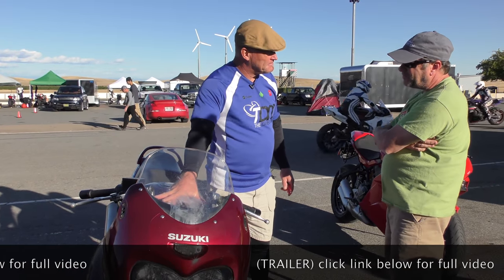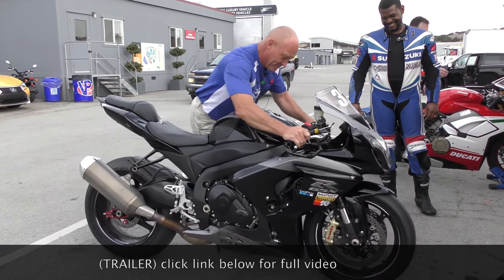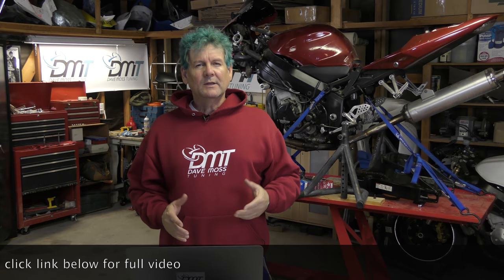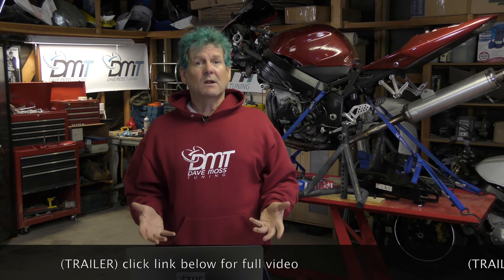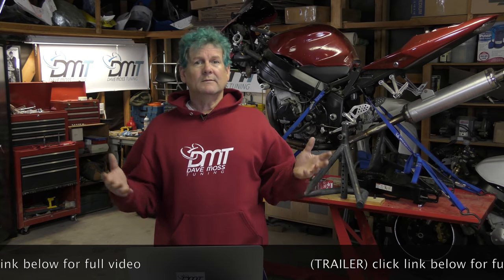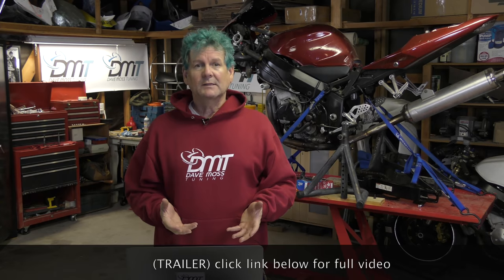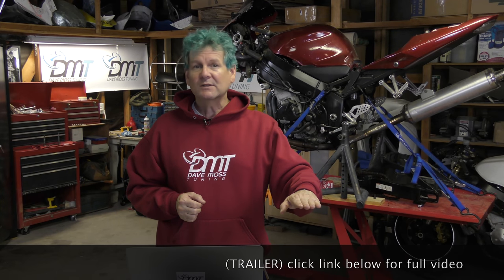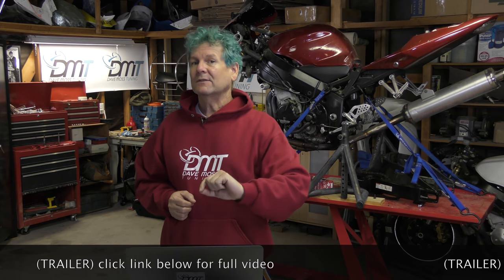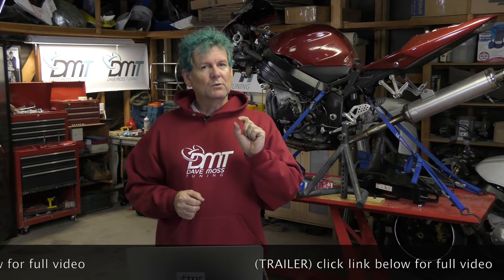Riding wise, you'll have to ride given what you have because I can't improve this at all. As with shock rebound, as you get closer to having it set right it might get a little frustrating — is it too slow? I thought it was too slow but it turned out to be just right. There's an entire video about how to bounce and set your rebound — the link is in the description below. You've just got to start bouncing bikes: get your buddies together, get in the garage, and start bouncing. Have your buddy try and set yours, then you try theirs. It's all in that video. Bottom line: start bouncing your bike, and don't worry about getting it perfecto mundo — Dave rarely does on the first time either. You have to read the tires after you go riding, and that's when you can really fine-tune it.